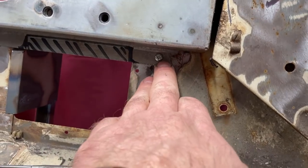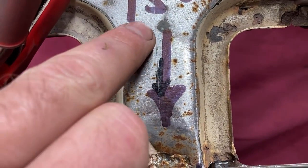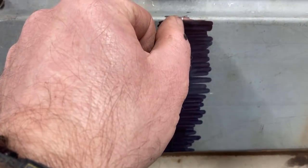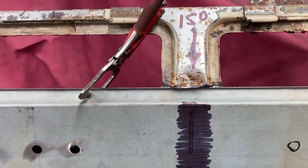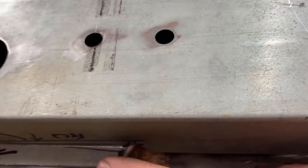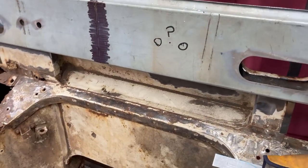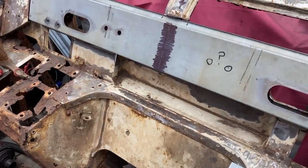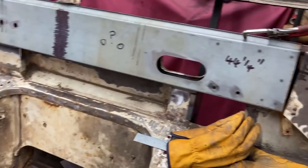So this is the rebate in the middle — that's all seated nice and tight in there. This is just sitting off a little bit — you can see the flex there. So I'm just going to basically get a line on it from here across and just tap it back a bit. It's not going to be any good trying to weld it with the TIG when there's a forty or sixty thou gap behind it. So I'm just going to ease it in a little bit with me tap it.